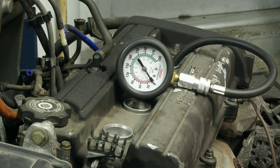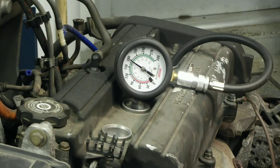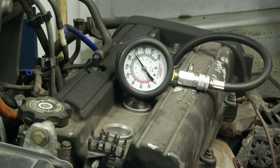So here we go. I'm going to compression test cylinder one. I've actually gone through all four cylinders and made sure that they were all good before making this video. So I'll just show you, for example, connecting the starter wire to the positive post. And that's that. As you can see, cylinder one is good at a little above 190, which I'm happy with. And all four cylinders come in at about that same number, so we're good.